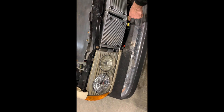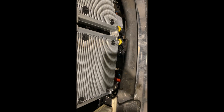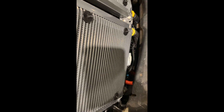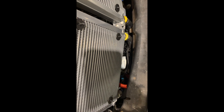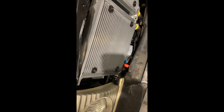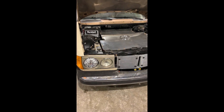Way down below is the DC to DC converter for a Chevy Volt — it's right below and behind the radiators with a cooling fan mounted on the front of it. For right now the fan runs all the time through a resistor because the fan was way too powerful for keeping that cool. In the future we might put a fan switch on there so it only kicks on some of the time.